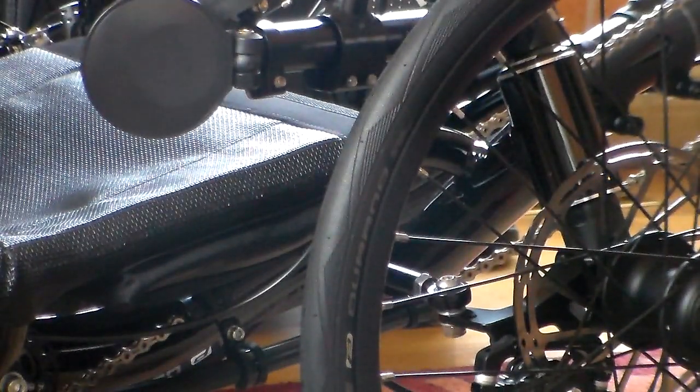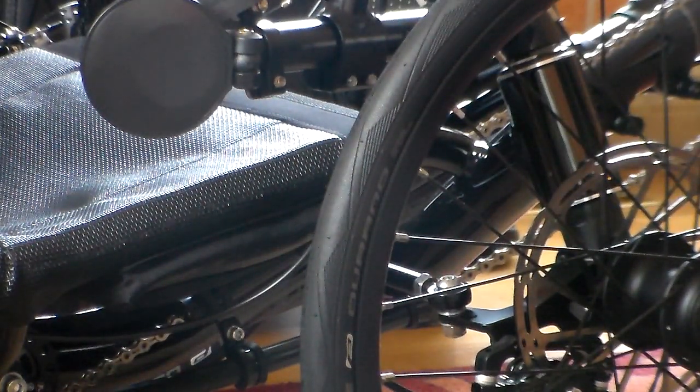The main reason I'm not going the external idler route is because it lowers the chain too far — the chain is low enough as it is. I wanted to keep the chain tucked up underneath the trike as much as I could, which is why I kept the tubes. The tubes on the Cat Trike come way too long, so I basically cut them in half. The bottom one is about a foot long — just long enough to guide the chain without banging on the frame. Same with the top tube — I cut it right down as short as it possibly could be.